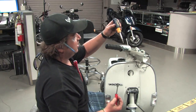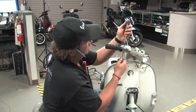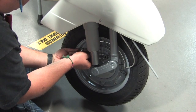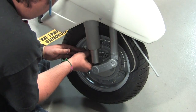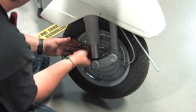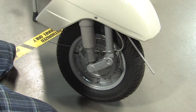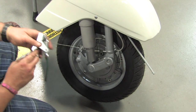The whole idea is that the nylock nut keeps the lever from vibrating between the washers — it pinches the whole thing down. Now Steve's going to thread the inner cable through the actual cable adjuster, pretty much right behind where the shock mounts. Feed the cable through and through the cable clamp that's been installed. There's a brand new cable clamp kit on the actual brake pivot pin, and the screw has a hole to thread the cable through. Steve's got the cable threaded through — he'll use the third-hand tool to take some of the slack out of the cable.